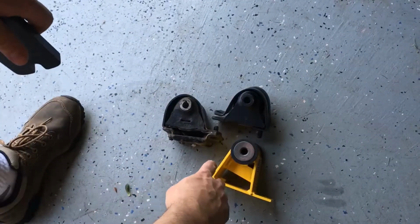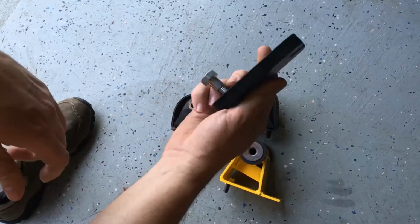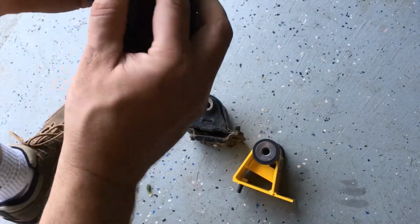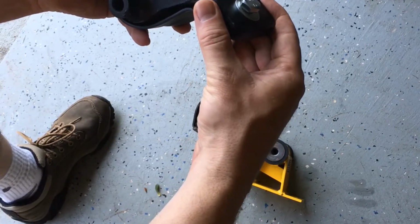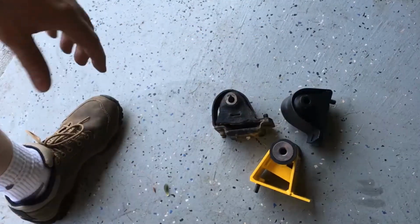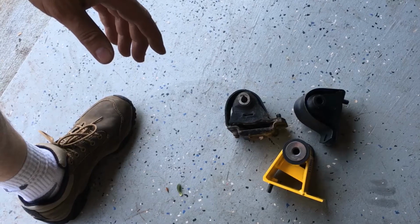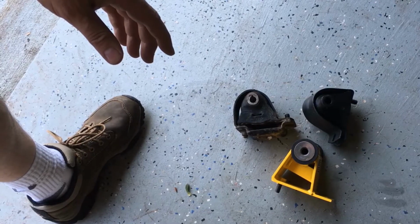So you have the option, when you get your TerraFlex belly pan, it comes with these spacers. It's a 5/8 inch spacer, which is designed to be mounted underneath here. It's got the bolt on it, and it mounts underneath this and gives you the lift that you need there on the engine. When I broke off this bolt on here, I decided I'll just go ahead and do it right and do the full 1 inch, also knowing that 1 inch would probably give me a little better angle for my driveline angles. And maybe I'll get into and explain those driveline angles. It's something that can be a little confusing.